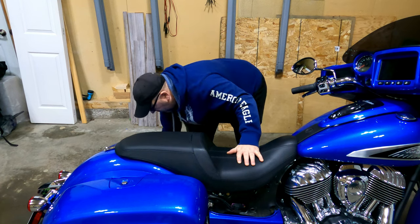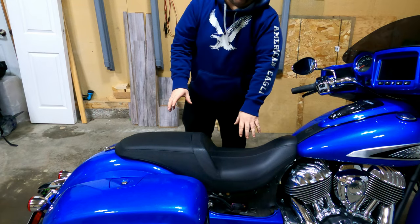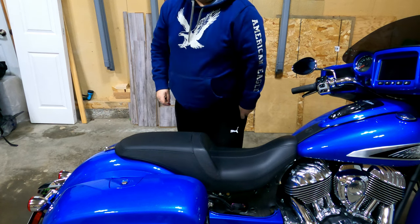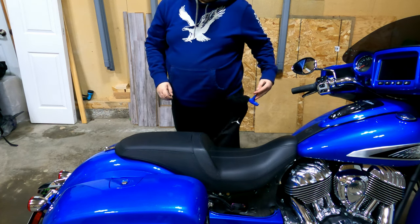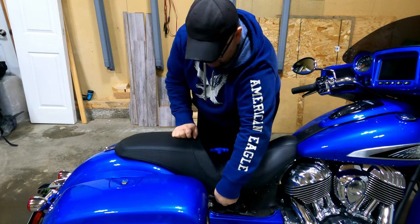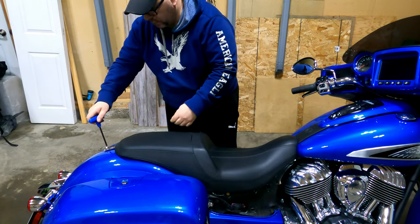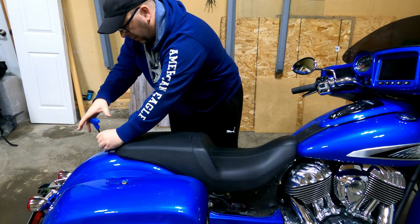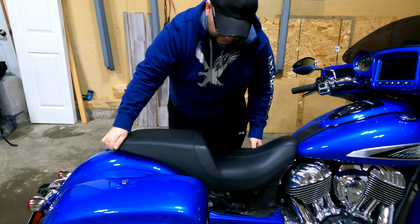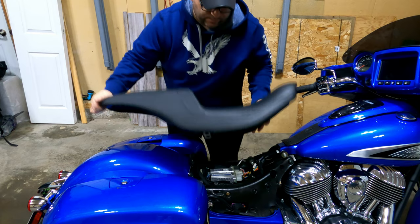You've got your two side panels, one on each side, so you need to pop those off. There are three bolts per side — one bolt right here, one on the other side in the exact same spot, plus one at the back. Those are all six-millimeter hex screws. I already did some of this already. To get the seat off after you take the bolts out, you just lift up on the back slightly and wiggle it out — that's it.